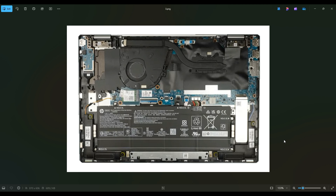As a general repair side note: whenever I'm working on a laptop, I have it sitting on an anti-static mat. Either that or an anti-static bracelet are great ideas to avoid damaging anything in your computer. If you'd like any help with tools or supplies for your repair projects, there'll be a link above and also below in the description with a list of the tools and supplies I use in my shop.